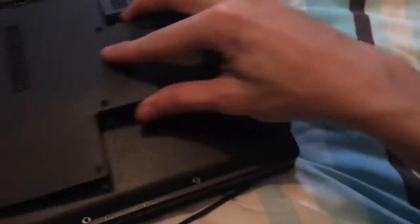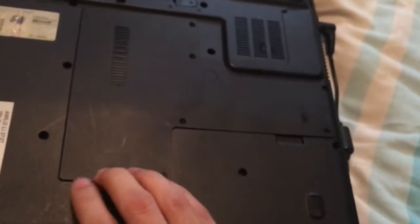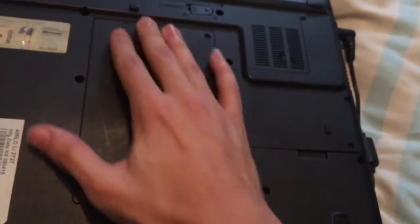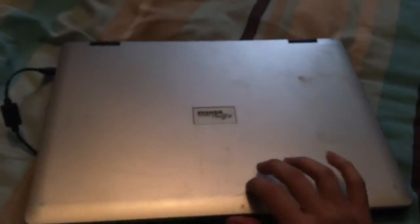It's the second highest one they've done. I've forgotten what the actual spec model for it is, but it was the highest they've ever done, or second highest. There's a 2.4 gigahertz one as well, but this chipset is a GL960. And officially, the GL960 doesn't support Core 2 Duos. It supports Pentium dual cores. That's when they started to do that.